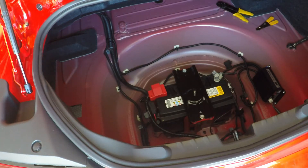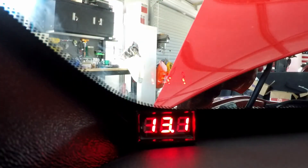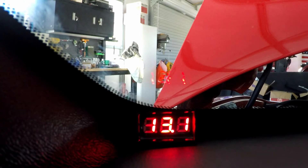Alright, I can see the gauge is working inside. What I do want to show you folks is how much current it draws. The fuel system control module in the 5th gen Camaro has power to it all the time — there is constantly a draw from the battery, even on the stock Camaro. So this is why there's a voltage on it now, because there is an output on the fuel module. The booster pump is also on because of that. Right now it's telling me it is at 13.1 volts. As I press on the gas pedal, you'll see the voltage going up. And that's to the floor — so it's sending 17.5 volts to the fuel system control module, raising the voltage to the fuel pump. That's all modulated by the accelerator pedal.